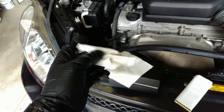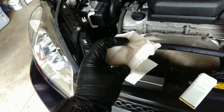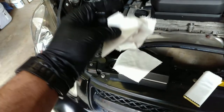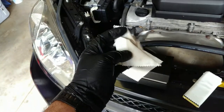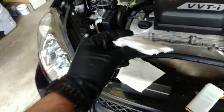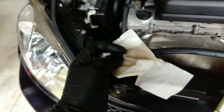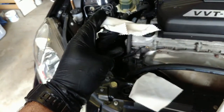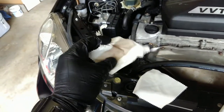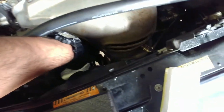The felt cloth looks very flimsy like this. Yesterday we did the same application, and to show you — this is how the coating has cured after one day. It's very hard; it cannot break apart, cannot move. You fold it back to original position. This is a very good sign of a good coating, because this is what happens when you apply coating and it's cured. Keep in mind this is only one day of curing — sometimes it can take many more hours or days.